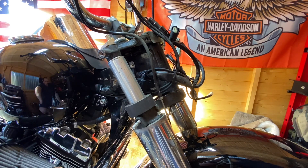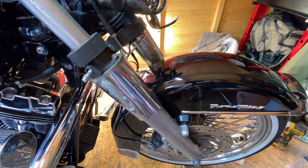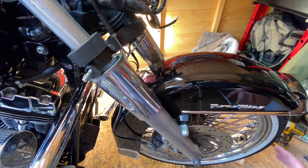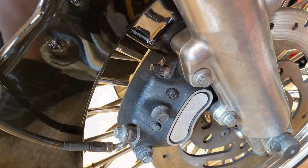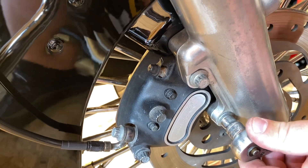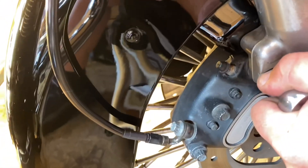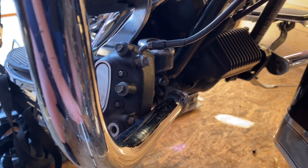Now what we have to do is go down and remove the front wheel, remove the fender, and remove the brake calipers. Set them all out of the way nice and safe and obviously we can slide the forks out and do what we're going to do. So the next job is to remove the brake calipers. These two bolts here — it's a multi-spline socket, I've got a 10mm that fits it snug. That's that side caliper off. Just put it towards the engine guard and secure it tight so it doesn't swing back and forth and damage anything or break a line. We'll do the same on the other side.